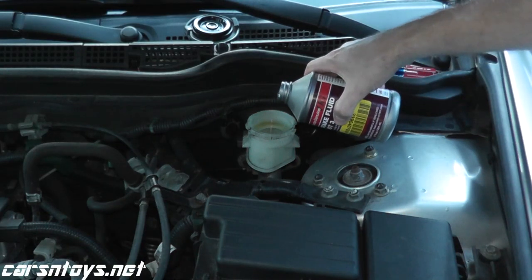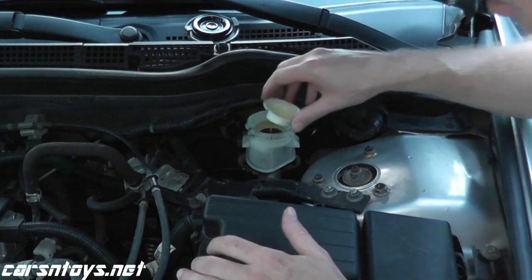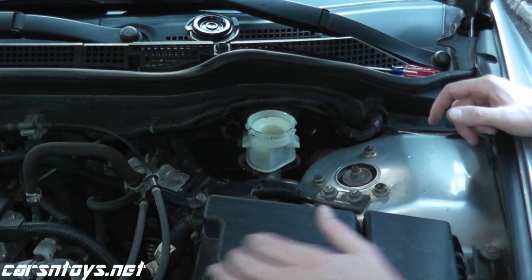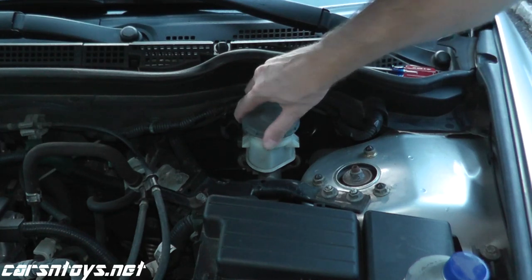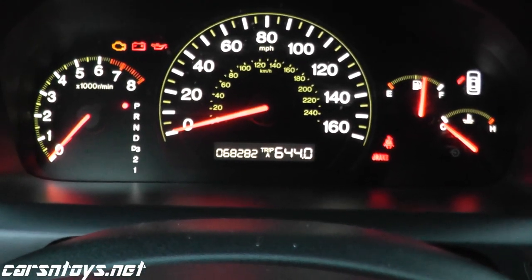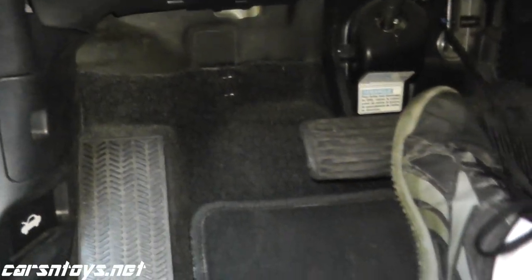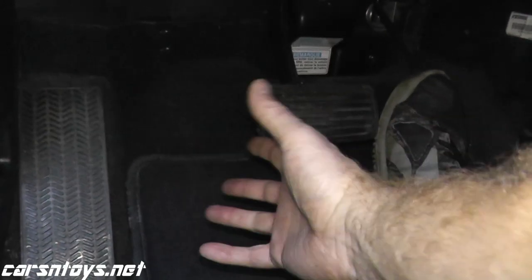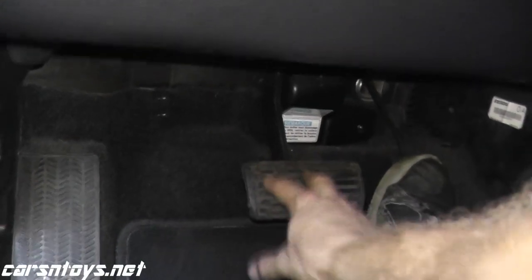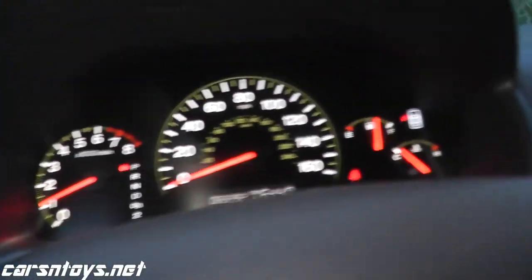Go ahead and reinstall the brake fluid, make sure you put the screen back in, and make everything nice and tight. Start the vehicle and make sure everything is in good shape. Press down on the brake pedal — it's still nice and firm. If the brake pedal goes all the way to the floor then you have air in the system; I'll include a link below on how to bleed the brakes. As long as you don't depress the brake pedal when the master cylinder is low on fluid, you'll be in good shape.